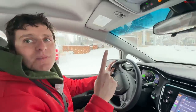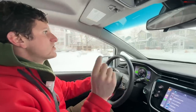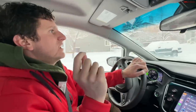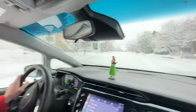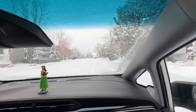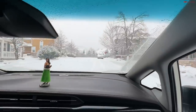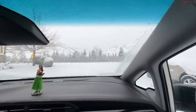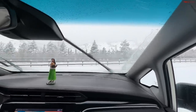One more thing — in a gasoline vehicle the traction control can only change engine output a few times a second, and you have to consider that with an internal combustion engine you've got torque curves, with different torque at different points. The great thing about an electric motor is that the computer has almost infinite adjustability when it comes to varying outputs and modulating to meet traction control needs, so you have really precise control over traction control performance in various conditions.